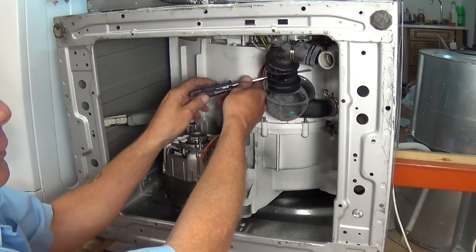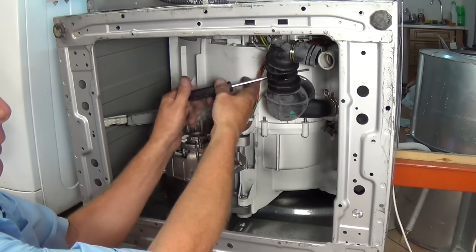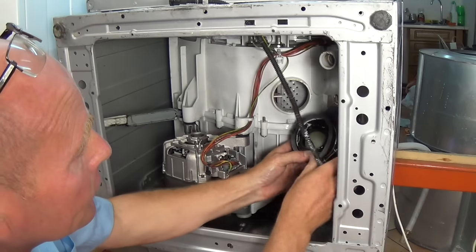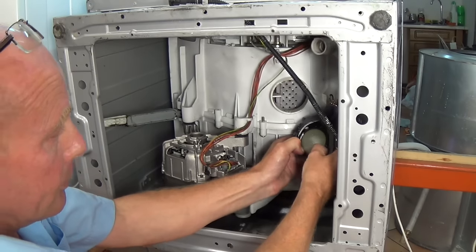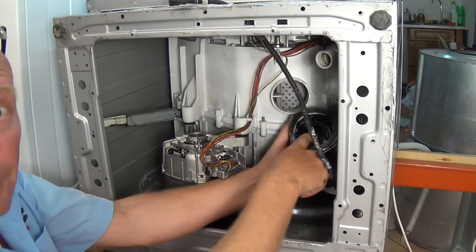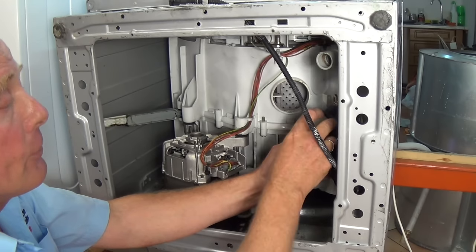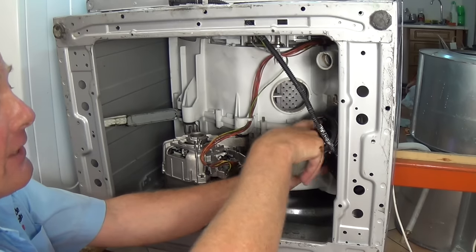While we've got this apart, we can also remove the hose using a screwdriver — whether it's a Torx, Phillips, or a nut and bolt — loosen it right off and it will come away. As you can see there is calcium in here. It's worth taking the ball out; it can be a bit difficult. Make sure this is completely and utterly clear. Clean the ball up as well, because if you don't use the machine for a long period of time these balls can stick against the rubber. Remove all the calcium from inside the hose.